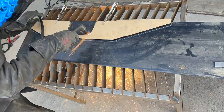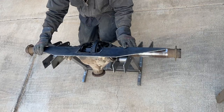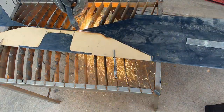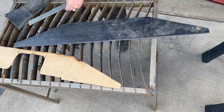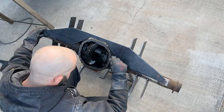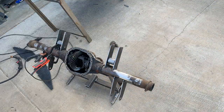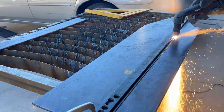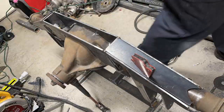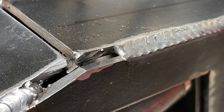Creating a wooden version of the front plate made a perfect template to copy onto steel plate. I'm using a plasma cutter, but if you've got a little patience, a cutoff wheel will work just fine. With the front plate done, we can use the basic shape of the template to create the rear plate, but the cutout to fit the differential will be a little different. On this plate, just straight angled cuts will be fine, and I'll use those angled cuts to help remove the factory Mustang axle bushings. The top plates will be cut into strips that can fit between the front and rear plates. This will create a nice valley for the weld bead to lay in, providing 100% penetration between the top and side plates.